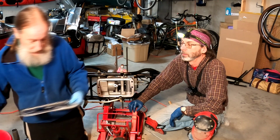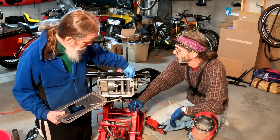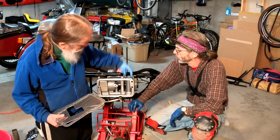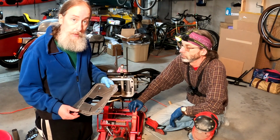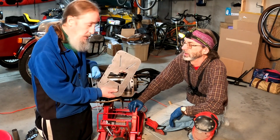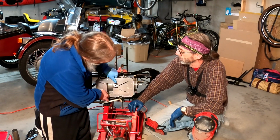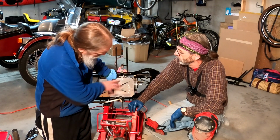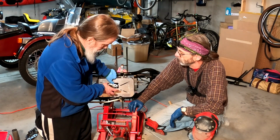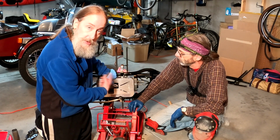This is the last piece of this puzzle. Craig got the steering tube in, and we got that set to the right depth, and we got the longer tube in, so now the oil will flow up out of that tube and out into the oil cooler. So the next piece is what they call a baffle plate. This plate's going to go on here, and that's supposed to keep the oil down into the pan so that the pickup that you saw us take off earlier has more oil to work from, and also to keep the oil from getting too foamy.